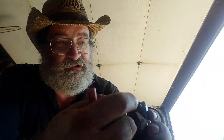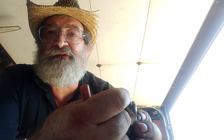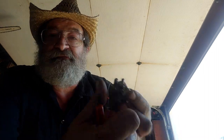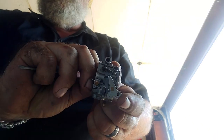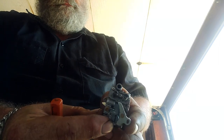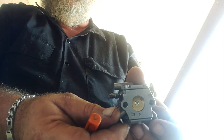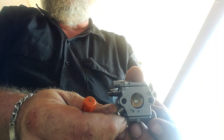So what do these screws have to do with the operation of the saw? You have three adjustment screws total. The low side is always closest to the engine - no matter what you're working on. The high side is farthest from the engine. And then you've got the idle screw. Basically, when you pull the trigger it flexes this little butterfly. When you tighten the idle screw, it just pulls that up a little bit, opening up that butterfly and letting more air in.